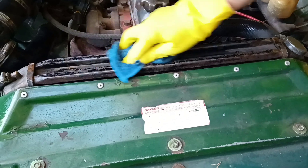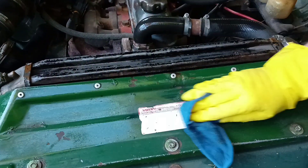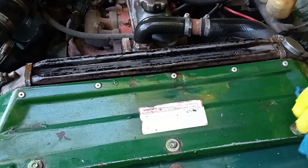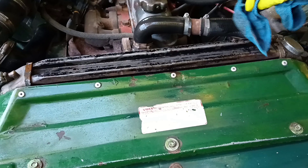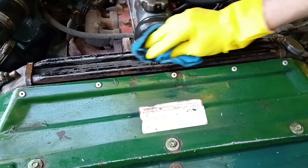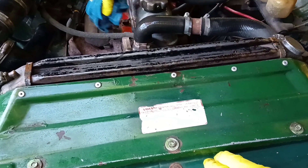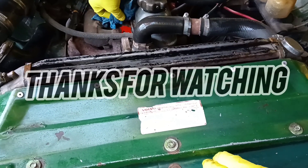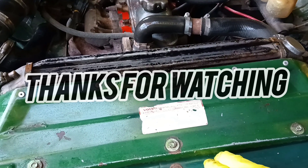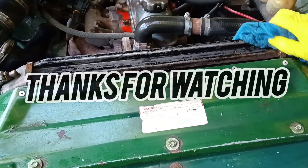There is the latest type of radiator which was used in the 140 series. In the next Volvo 240 series there was an absolutely different radiator and cooling system — the design was different. You could probably use a radiator from the 240 series, but you don't have to. You can also clean the engine with the same rag if it has no oil leaks.